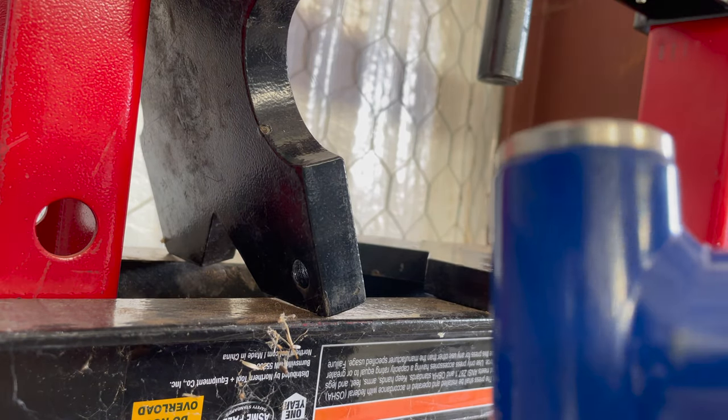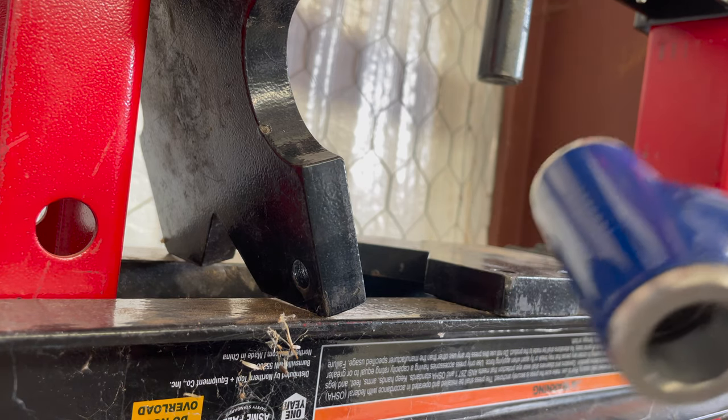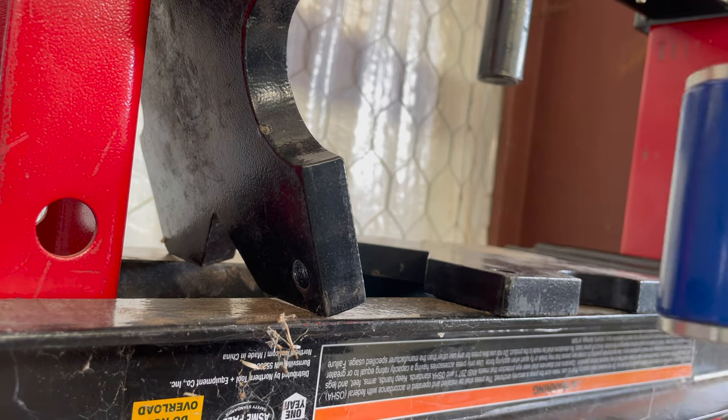There's still a little bit of a gap — what's happening is I'm hitting that steel collar on the inside, which is in fact the limit of how far I can compress with it in there. So I take it out and give it one more millimeter — just to get that last little gap between the bushing and the A-arm. I push the collar out and give it one more little squeeze. Now those bushings are right up against the A-arm.